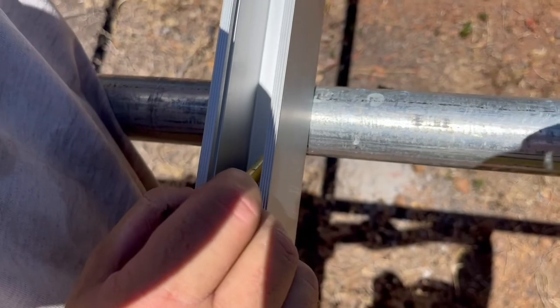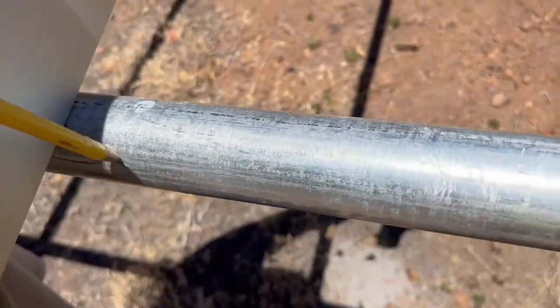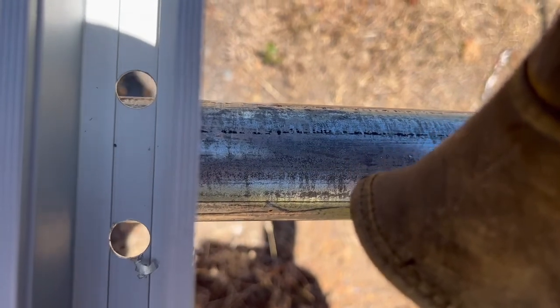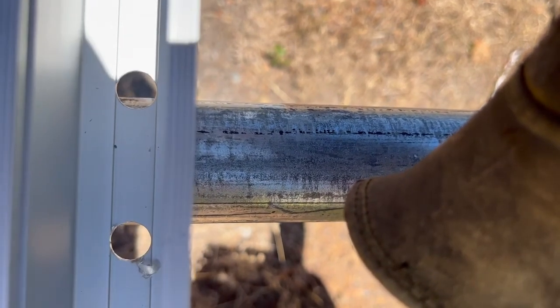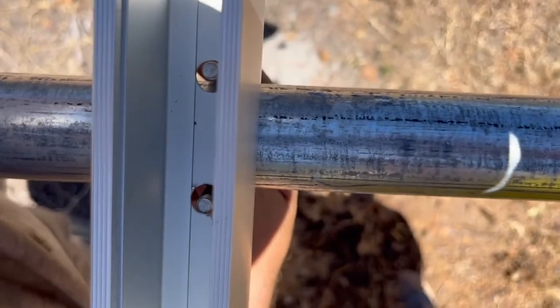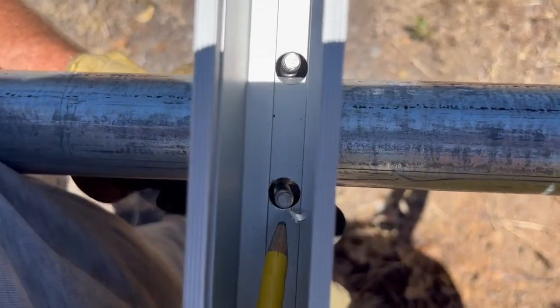To give us the proper measurements — put your camera right down — hopefully you can see that the inside of the hole lands right where you want the edge of the hole to be flush with the tube. You can see how it's not right there. Now put the U-bolt in and see how difficult this is — it does not go straight in. Even if you move it, it's still hitting. I'm a big believer in only drilling the size holes you need. Had they given us the proper measurements, a 5/16 hole would have sufficed.